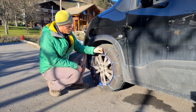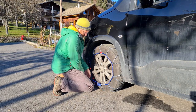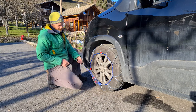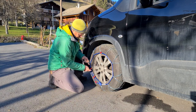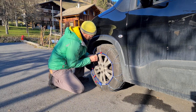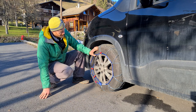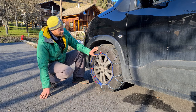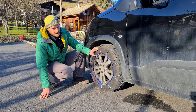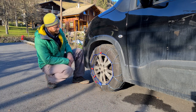Okay, the chain has loosened off a bit which is what you'd expect, so you need to just unhook that, tighten it up, and now I have enough chain to pop through both hooks and then pop that on. These chains are pretty much the cheapest you can get at 65 euros, and they're not quick-tightening. I'm going to show you a pair of chains that do that — the quick-tightening chains just save you that extra check where you've driven, stopped, and gone to re-tighten them.